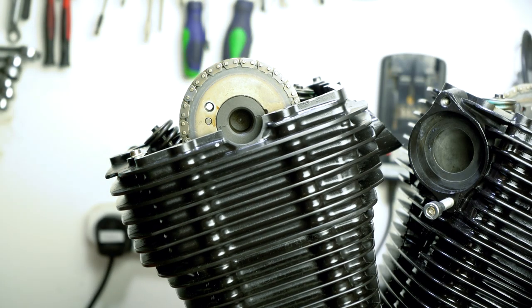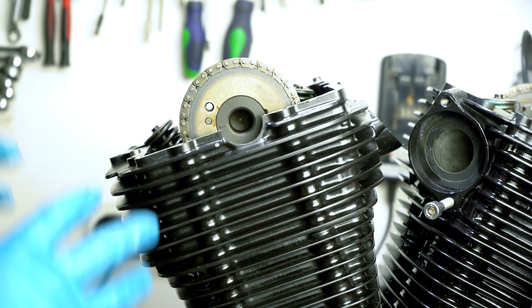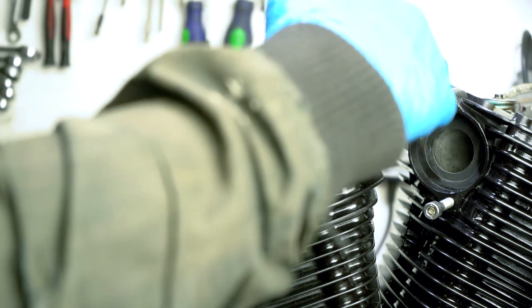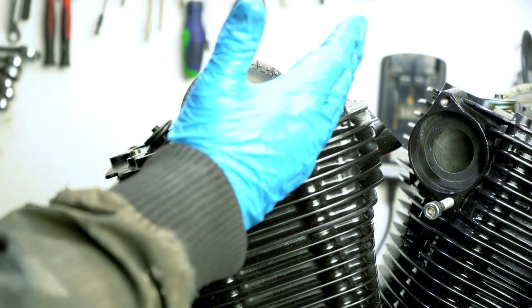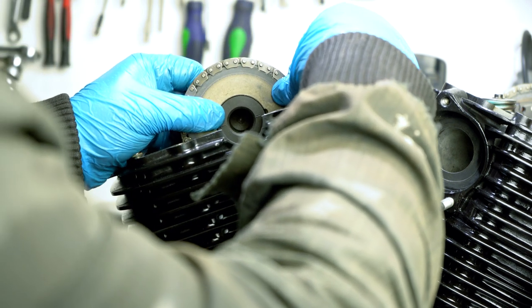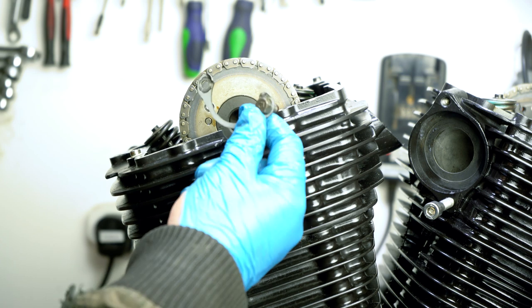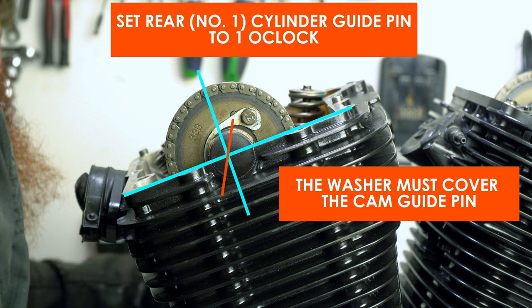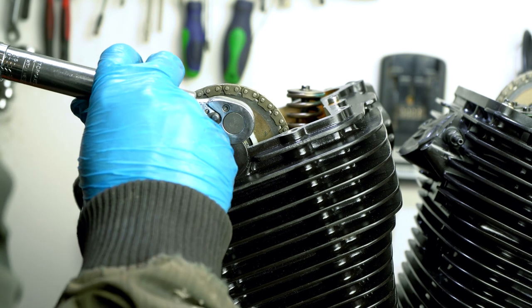So that's number one done, and it is the same process for the rear. If you're facing the rear cylinder in the same way as the front, the arrow would still need to come the same way. We still want the cam chain tensioner to be loose so we've got excess on the chain. The only difference is that the sprocket and the cam need to align to a different point on the engine. Once this is on, add the washer — you might remember this from the previous video where I took this all apart. Then grab the torque wrench again: 14 to 16 newton meters.